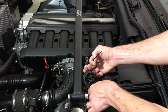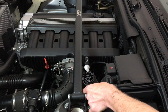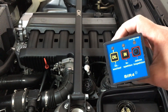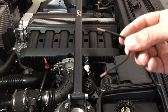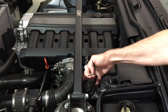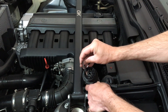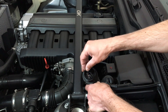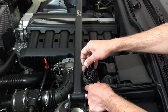For oil inspection, unless you don't have a fancy thing like this, you can do it with a wire. Take a wire like this, go to your OBD port, put in pin 19 and pin 7. Hold it more than 3 seconds, and then your oil is reset.